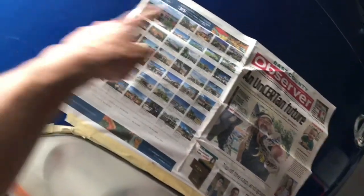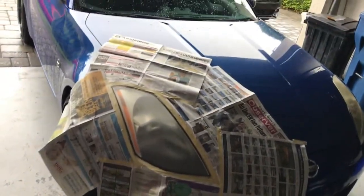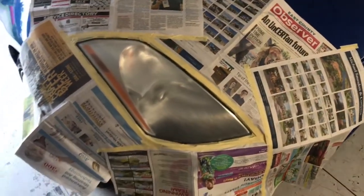Get the newspaper and tape over the tape. When you're taping down the newspaper, make sure you tape everything and don't leave any holes because it'll blow through and get all over your hood. Here's how it should look all masked off — make sure you get it far enough away so you're not spraying onto your hood. It's just clear coat so you won't really see overspray, but just mask it off really nicely and take your time. The mask job really is the key — prepping is everything. I'd use a respirator when spraying clear because it's just not good for you — it's really contaminated.